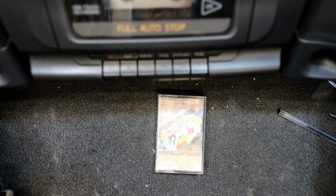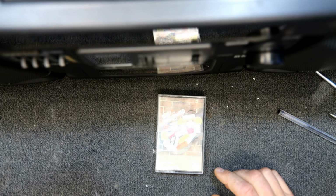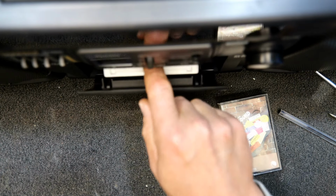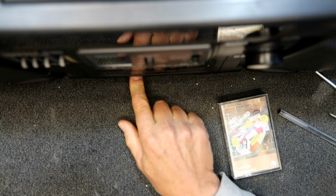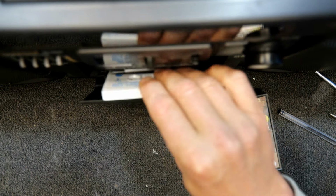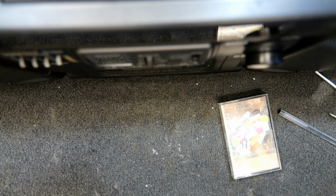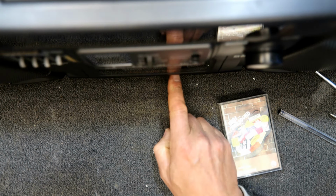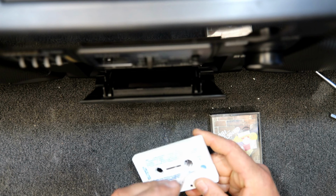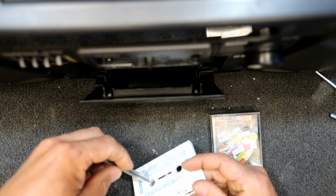So that's using the Panasonic, what is it, RX DS520, which is a much newer box. I don't think I put new belts in this one either, but that's certainly playing better. So it's probably a good tape to test whether the belts are slipping or not, but it still doesn't sound 100%. Not as noticeable on that track on the other side, but the Flowers song is still playing up. So it goes to show wow can be caused by tapes. Strange not to feel anything in there though, unless it is something to do with I've rewound it through once, or nearly twice I think.